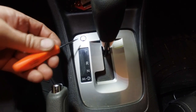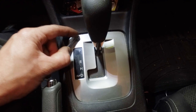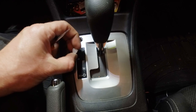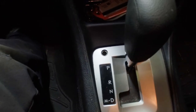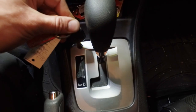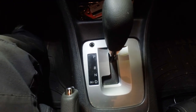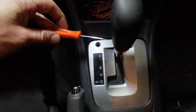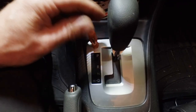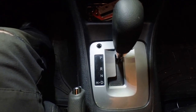This could be difficult if you don't have any tools in your vehicle. Hopefully you have a small screwdriver, a hairpin, something to pop this cover up. You just pop it straight up — don't lose it because you need to put it back in place when you're done. Inside that hole, most vehicles you can stick the key in and push down to get the shifter out of park. On this vehicle that does not work — the key doesn't fit down into the slot, and even this screwdriver isn't long enough to push the button to get it into neutral.